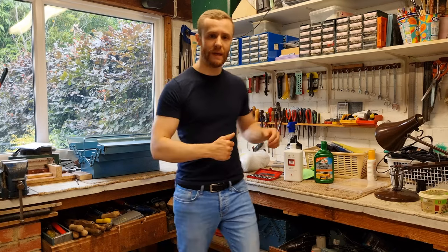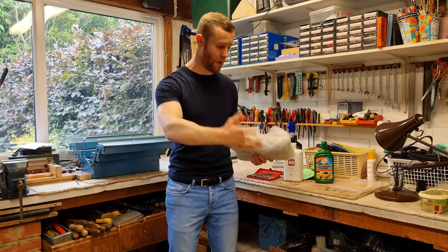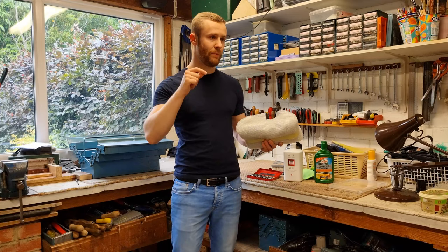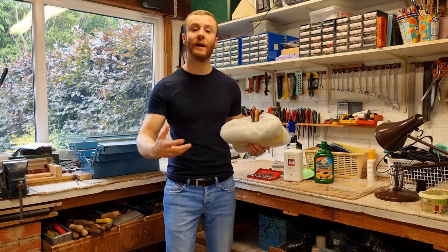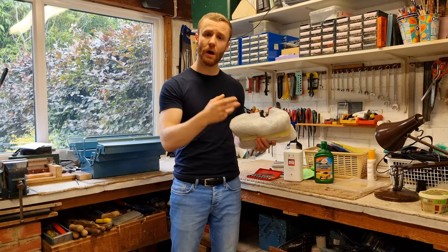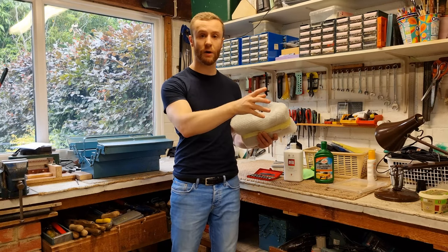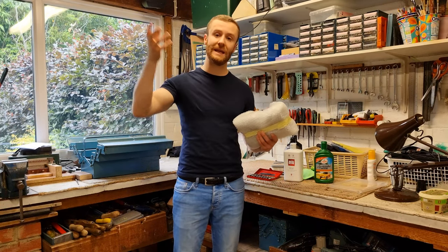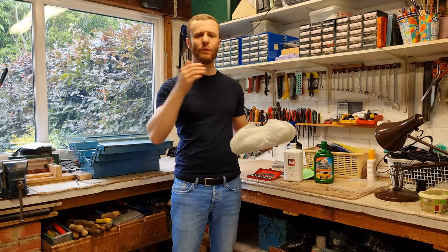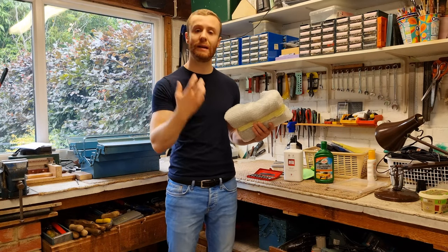So a little bit of an update on the exhaust. I didn't want this to be a clickbaity, I've got an Armytrix straight pipe exhaust. On the Jaguar XKRs, the exhausts are pretty unrestrictive anyway, because they are more sport and performance orientated cars. The XKRs have got pre-cats on the cross section. The XKRs and the XKRSs have got obviously cats, quite high flow cats on the downpipes. They're still in place. But there was a cross section on the centre pipe of the exhaust that I had a feeling was a little bit restrictive.